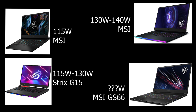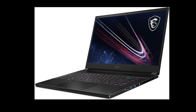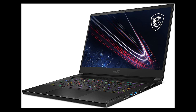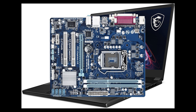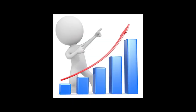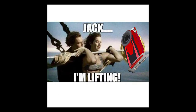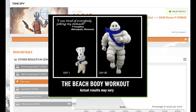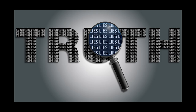But a lot of people have had excellent results with some of these 140 watt ones and the shunt mod one. The MSI GS66 shunt mod is the most different out of all of these — this one I think was stumbled upon by accident. It essentially has a bug that actually works as an advantage for performance. What happens is your system will only think that you're using like 30 or 40 watts of your GPU when really you're using like 140. Unfortunately, you're not going to get a completely accurate reading, but based on people's performance scores it seems to roughly equal about 140 watts. The only downside is you won't be able to tell the true wattage.